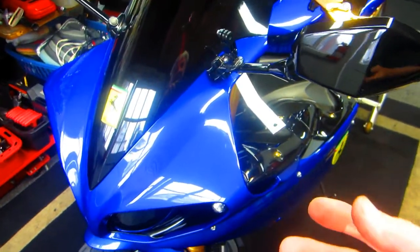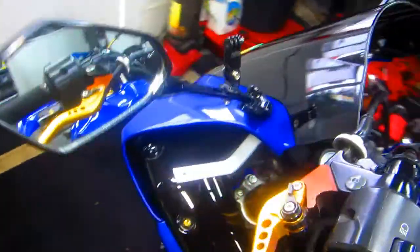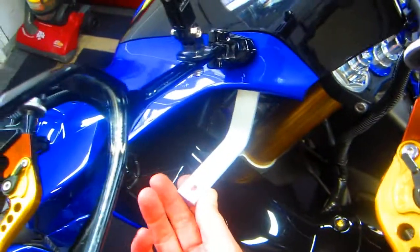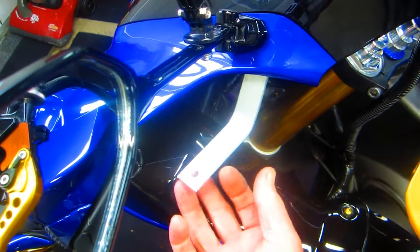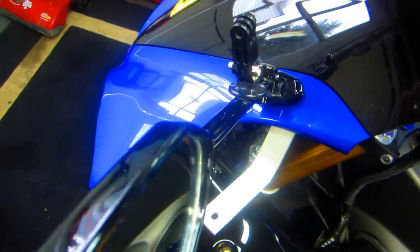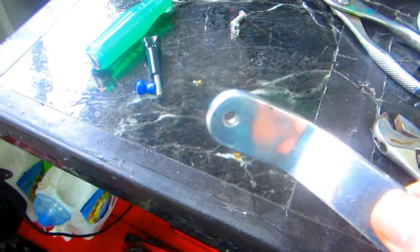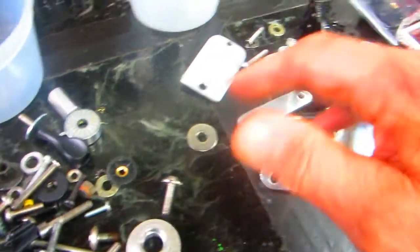Now, what I started by doing is making an adjustable bracket. And when I mean adjustable, there's several different settings that I can use. Now here's the thing I've learned about making camera mounts. When you make a camera mount, you always make a prototype out of 1/8 inch. The 1/8 inch bends beautifully. Then when you're all done, and let me just show this, you make it at 1/4 inch and polish it. So I have made many 1/8 inch ones that just vibrate too much.